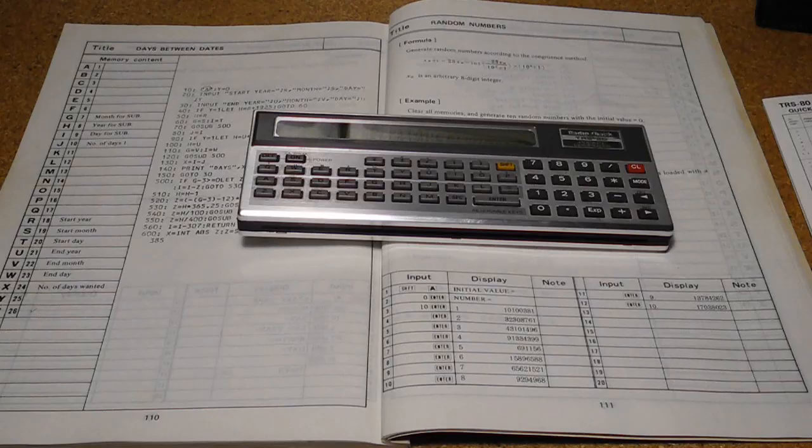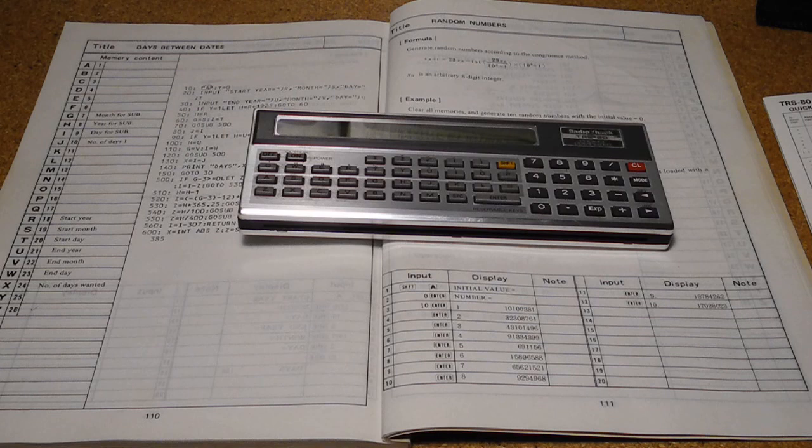The software is a little unusual, differing from both a calculator and a desktop computer. It cannot operate like a standard algebraic calculator, but can only be programmed using BASIC. It has four modes: Run mode allows evaluating BASIC expressions and commands immediately without line numbers; Program mode is used for entering and editing BASIC programs; Definable mode is used for running what are known as defined programs; and Reserve Program mode allows running definable programs associated with a specific key. I'll show examples in the demonstration later in the video.